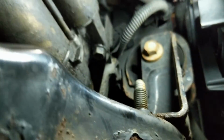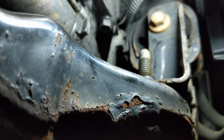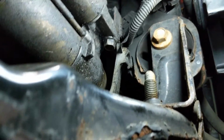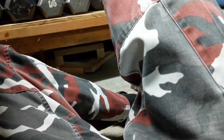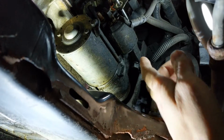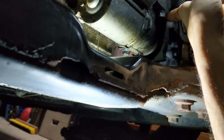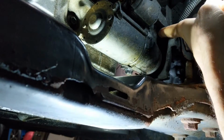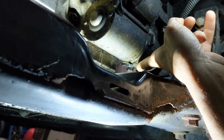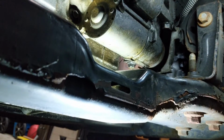And those look like they are bigger than, definitely bigger than the 13 mil. So I'm going to tell you guys what size those are too. Well, I had to go to the store and grab some tools because I didn't have a 15 mil. But these 2 are 15mm nuts. Got that one there and that one right there in the background. So 2 we need to pull off. Let's get those off of there, shall we?